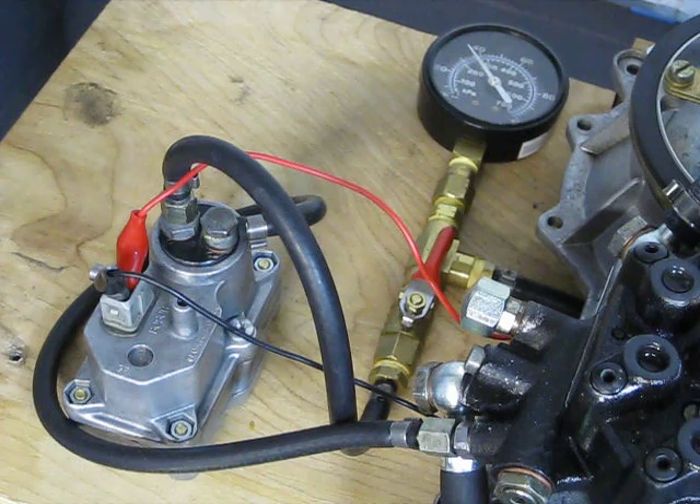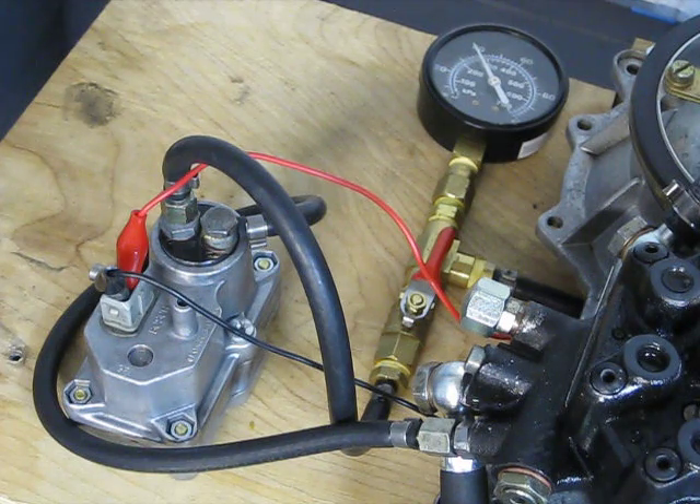This is where I'll add music because waiting for this is a little bit boring. You can see the pressure's rising — we're at about 38 PSI now. The warm setting we're trying to achieve here is about 42 to 44 PSI. That's at 100 degrees Fahrenheit.